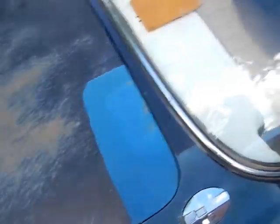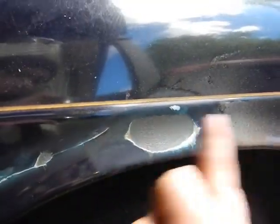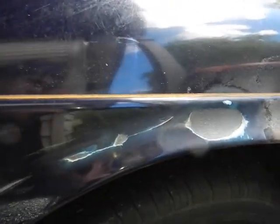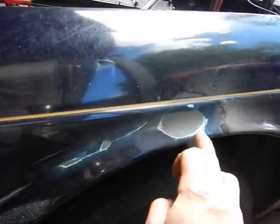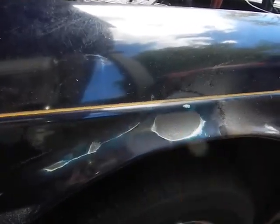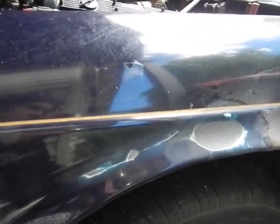A bit of dirt fix in at that. I'll just rust treat that and paint it over. It'll look like a craterous hole because of the body filler. I'm not going to waste much time at all. I want to get this all done by a professional. So I'll strip it all back. I'm just going to fix certain spots like that, just so it doesn't get evil and rust through. I'll leave some stuff for now until it gets worse. But I'll just do patches on it until the thing gets painted.